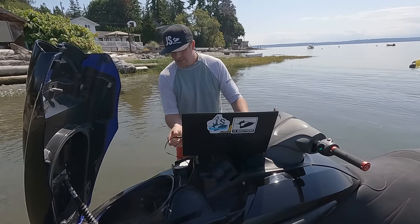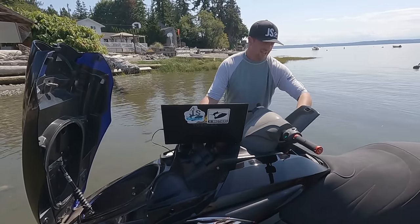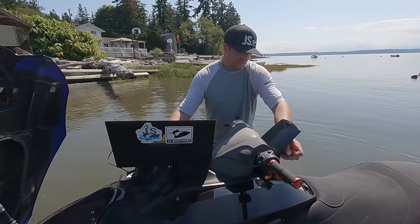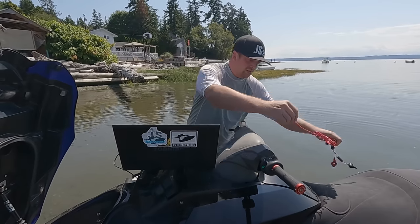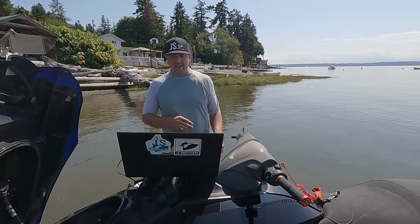It definitely didn't look as crazy as it did the other day when it had double the boost. Well, I'm not sure what the boost will be at because you change the springs and it's not like one-to-one for when you change it. No, no. Like last time we were on 8.5 pound springs and it was like 10 and a half pounds boost.